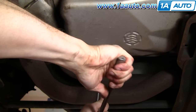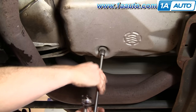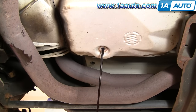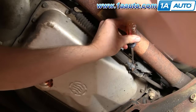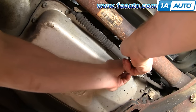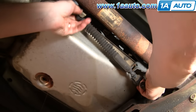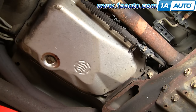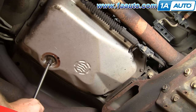The nice thing about these trucks is you don't even have to jack them up to get underneath. This is a 15-millimeter drain plug on the transmission pan. You want to remove it and let the transmission fluid drain into a catch pan. Once the transmission is draining, I'll put my plug back in — and make sure whenever you reinstall a plug, always tighten it up to be sure.